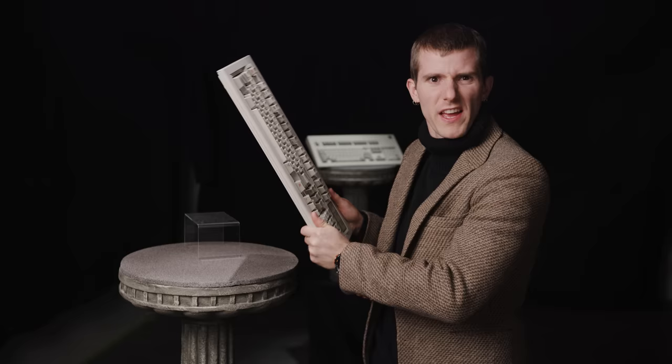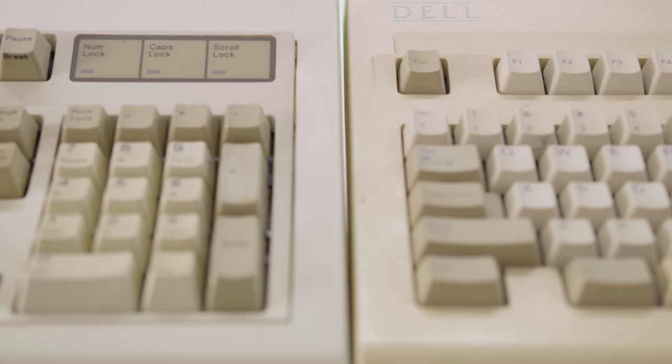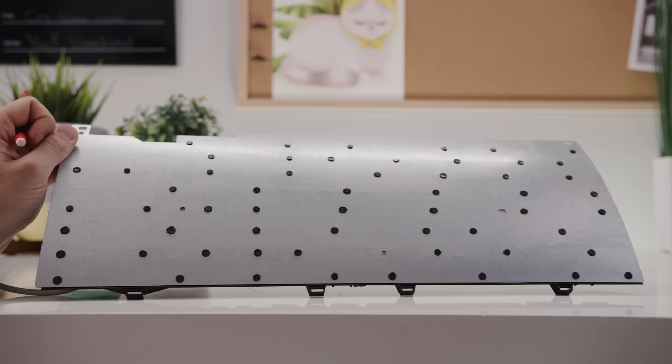Well, actually some Model M's do use rubber domes — more on that later. The result is a very balanced feel with a nice tactile bump and a 70-gram weighting. For pure typists, there's very little on the market, even all these decades later, that feels this good. The buckling spring switches create auditory feedback that some find very satisfying, though they also take longer to register repeated strokes, making them unsuitable for competitive gaming. The Model M's are heavy boards — the plastic shell and keycaps are made from hard PVC and PBT plastics that aren't painted and don't yellow with age, and inside there's a heat-treated metal backplate responsible for the M's negligible deck flex and its five-pound heft.